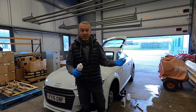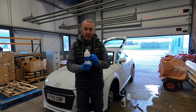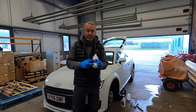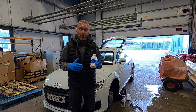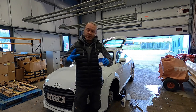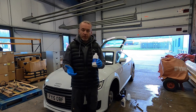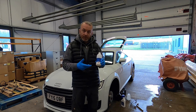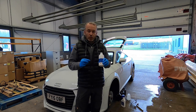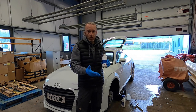I'm not going to kick the ass out of this summary - the video demonstration says it all. Bilt Hamber Atom Mac - waterborne, migratory, anti-corrosive - it works. Some top tips: spray on, let it dry. Remember the water is just the carrier to allow it to get into all the nooks and crannies - let the water flash off to leave the protective coating on the disc or wherever you're spraying it. If you're doing a full detail, spray it on, do your citrus and snow foam, spray it on again, do your shampoo and rinse down. Once you've dried it using an air dryer, get some on straight away to give that longevity and protection after the wash process.